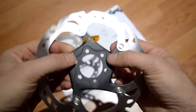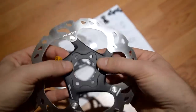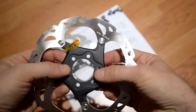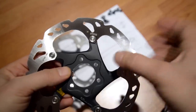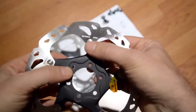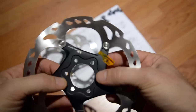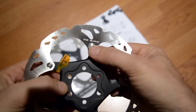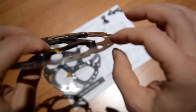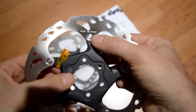On the outside, you have all the little instructions and information etched on the surface. The little warning label here is just referring to touching the brake surface, which is not recommended with bare hands. You can see the sense of rotation right here. These are the RT86 SM RT86S, made in Japan. One last instruction here is the minimum thickness of the disc — if you're getting down to 1.5 mm, they recommend you replace it.